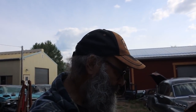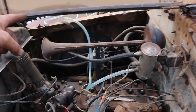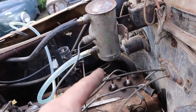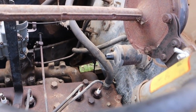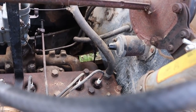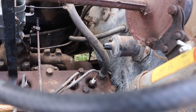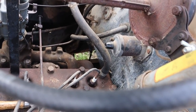Alright, I spared us the gory details, and I've rigged up the old Will It Run rig here, and let's see where we're at. Got our electric fuel pump. I've robbed a coil from a different car because these cars have a very clever and crafty design. You see how the positive post is missing there? It actually comes out the back and goes directly to the ignition switch, and it's all in a very nice armored insulator to discourage theft, which is a nice idea.